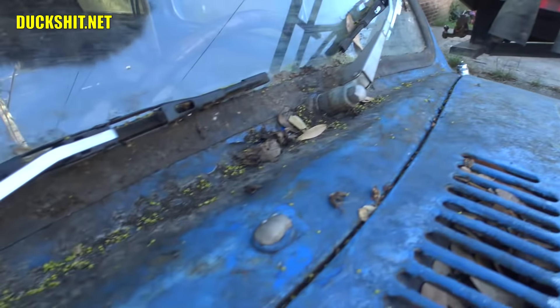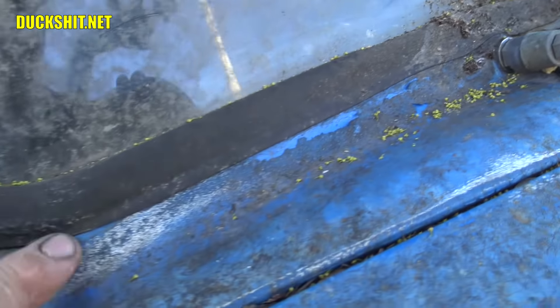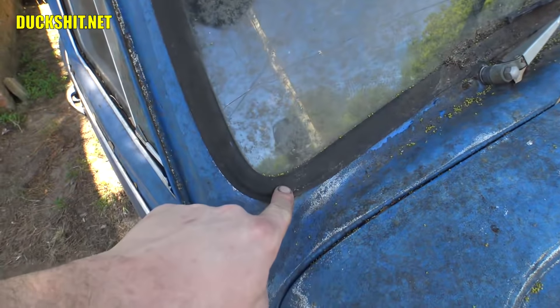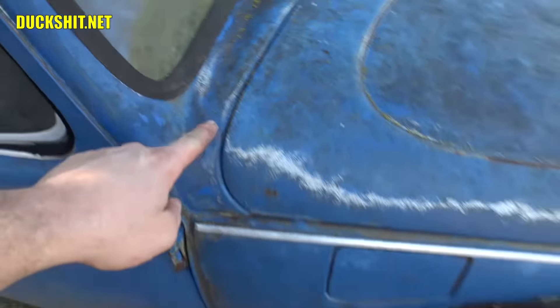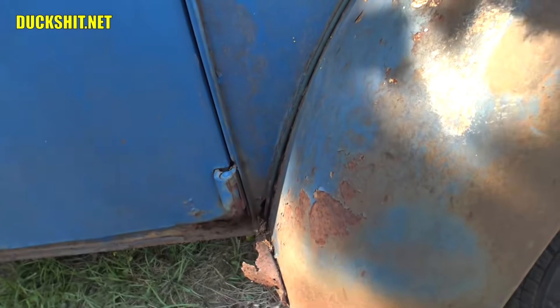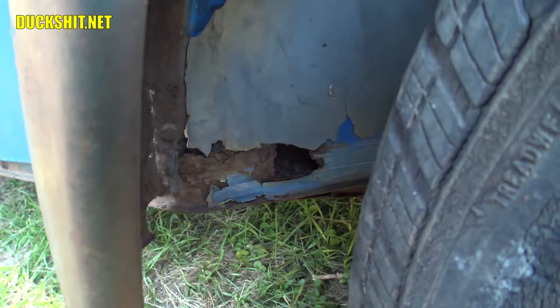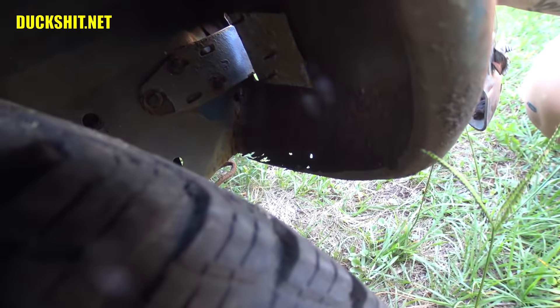Looking at the lower window seal, I'm not seeing much rust, though there might be a little bit bleeding through here in the corner — very common. There are two little weep holes in these corners. The water that's allowed to escape through the weep holes actually drips down into the body and causes these sections down here to rot out. So we need to have a look inside underneath these fenders. Looking up under here — we have another rust hole up in the front quarter that's going to need to be addressed. Going up and over the top, I'm seeing light coming through — we got some rust holes up here in the fender. The quarter looks pretty good, I don't see any crash damage — that's really good. And down at the bottom there are a bunch of pinholes in the front fender too, so that will need to be repaired or replaced. I think I can fix these fenders — not too big of a deal.